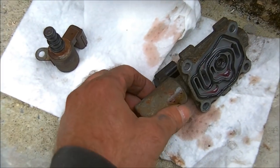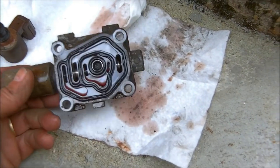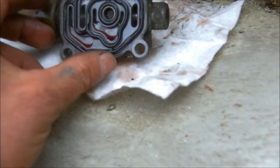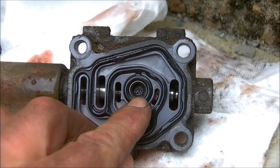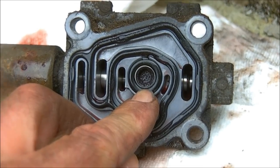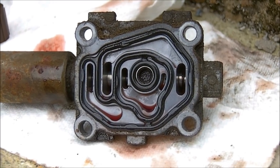The other one I took off — the one with the four screws — is actually encouraging because I'm hopeful it's going to help solve our problem. Right there is a screen, and on mine it's just full of crud; there's no way much is flowing through that. Hopefully we've cleaned that up, put it back, I'll swap the fluid out again, and we'll see what happens.